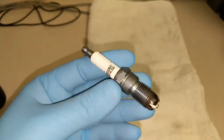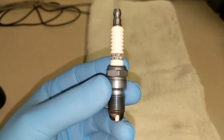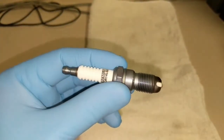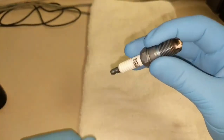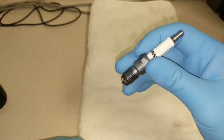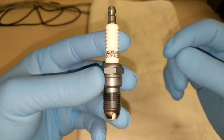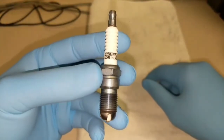From what we've seen in testing, we're averaging at least four more horsepower with these versus the NGK TR6s. Even though we're still tuning so I can't give you a final number of exactly how much more power this plug makes, we have seen better overall idle, better part throttle, better revving, and ultimately the pulls that had higher horsepower and torque numbers were when we had the Brisk spark plugs in the car.